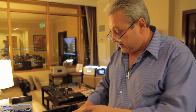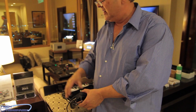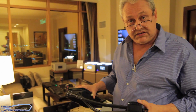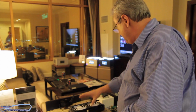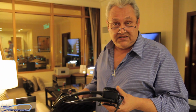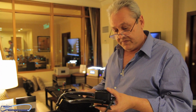So we're capable of driving a multiple number of devices thanks to the power of that pump. For reference, that pump is a 6 watts pump, whereas the pumps offered by the competition are about 1.2 watts, if I'm not mistaken. So it is 5 times more powerful. And we also designed the pump to be extremely quiet, and for a very long life. For reference again, the MTBF, the mean time between failure, on the MCP35X is 50,000 hours. The MTBF on this product is 60,000 hours. So it is a high reliability pump.